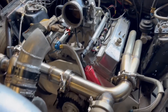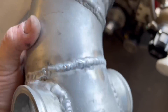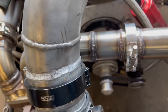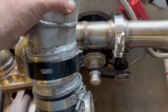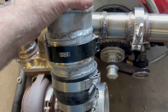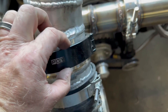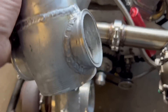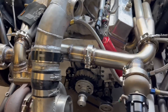We're making some progress here — some decent weld stacks there. Now we are pretty close. We've got the flexibility down here, and this PQY clamp — they make a whole bunch of different ones. Vibrant is the one we used to see all the time. It's clamped here on a rubber mount, kind of tight. The flexibility is unbelievable — it's got an o-ring on this side, an o-ring on that side, and then a sleeve that encapsulates it. It moves but it can't blow off. It is amazing. This is going to work out just like I had hoped.